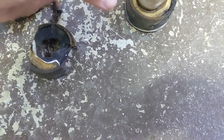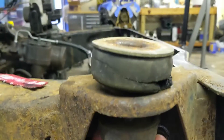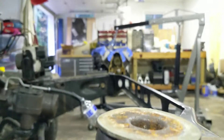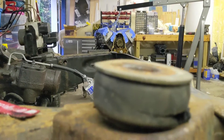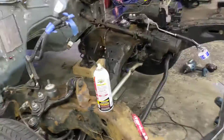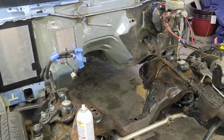So that goes in from that direction and basically they sit like this. This comes up from the bottom, and then there's a big bolt that comes through — but the bolt isn't threaded all the way through there; it's only threaded up top where the nut would go to hold the body onto the mount. So hopefully we're going to be able to get the rest of these out without using a sawzall or a grinder, because that's really going to make it a pain in the ass for the next 14 mounts. We'll update you guys when we get to that.